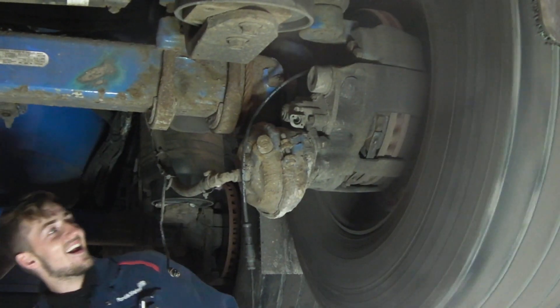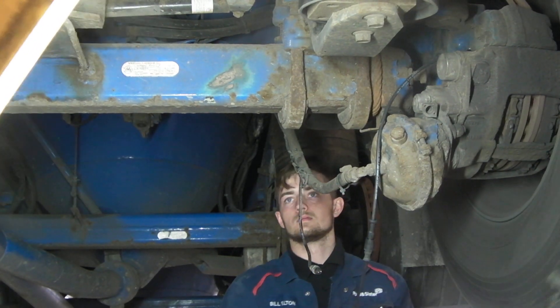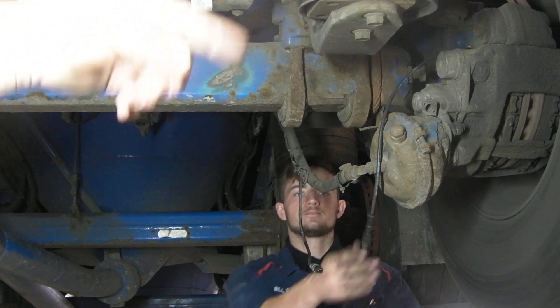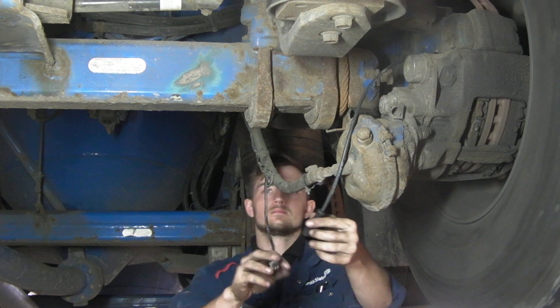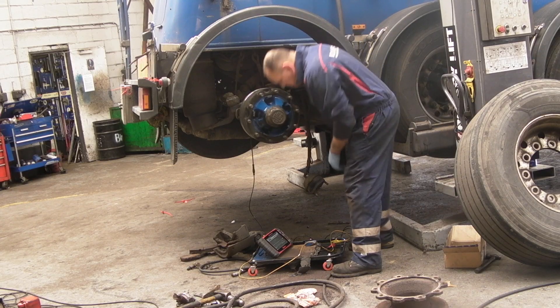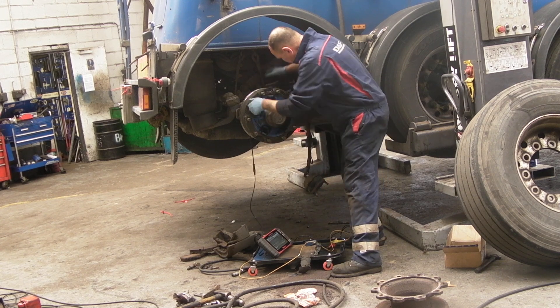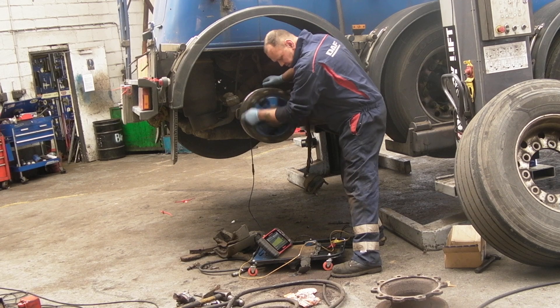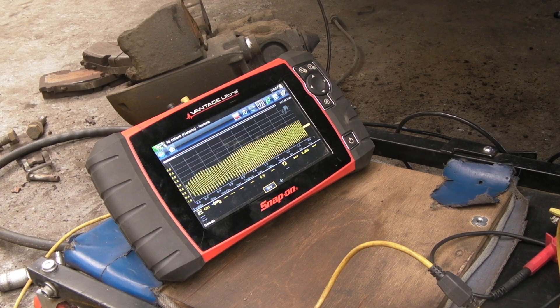Just got to show you who's spinning the wheel — yeah, wheel's spinning! So if you can just route that cable a bit longer, route it properly — get that sorted. We've also got to put a plug on the front here. I also use the oscilloscope during assembly when I'm putting stuff back together. In this case it had a new exciter ring. It's basically a quick way of making sure I've got a decent signal — and yeah, that looks fine, that's okay.